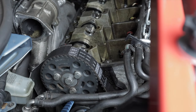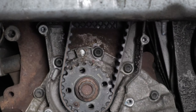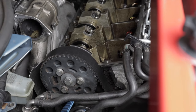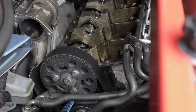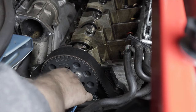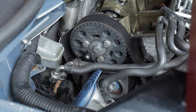Remove the pin out of the top on the camshaft, and pull the crankshaft locking tool out as well. You want to rotate the engine a full rotation — the crank goes around twice to the camshaft once. Here's the engine being turned around. Once it's back to position, check if you can get your crank pin in. As you can see, the camshaft is lined up. Put the pin in just to check — it's gone in. Do the same with the crankshaft — all the way in. The cam and crankshaft are now fully lined up. That's perfect.